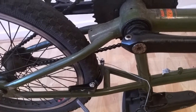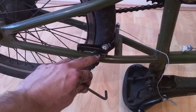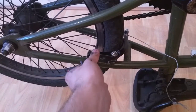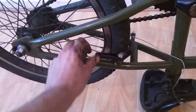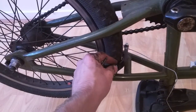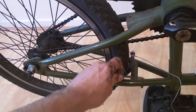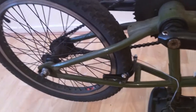If you ever find that your brakes are sticking on the rim, it's either because the bolt or screw isn't set properly — it's too far into the rim — meaning there's not enough tension on the spring inside. Add more tension and that will move the caliper further away. If it's constantly stuck in, you'll probably find that the bolt has just loosened off a tiny bit — that's what happened to me this morning and is my reason for making this video. Just check if it's loose, move the caliper arm back, and tighten it back in.